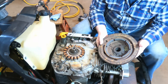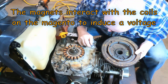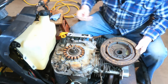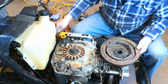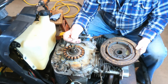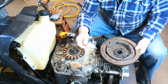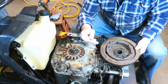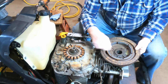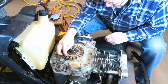The magnet was holding it together. Inside there are magnets around here, and there's also a keyway that I just heard fall out. There it is down there under the coils. We want to make sure we hold on to that key because we don't want to lose it. Another thing that can happen: if the firing gets out of whack — if you're getting a lot of backfiring — sometimes this key will be deformed, because it also sets up the timing in relation to the coil. So this is the magneto.